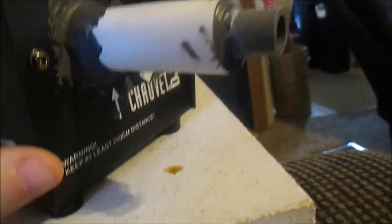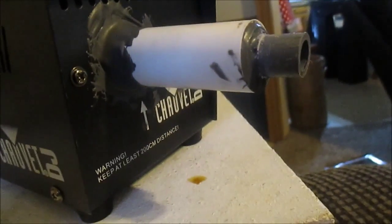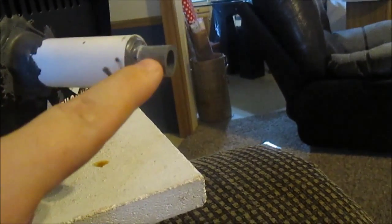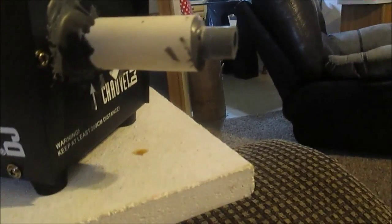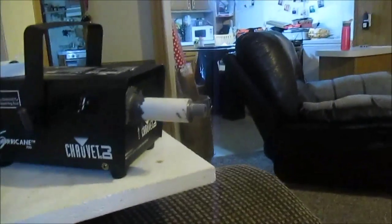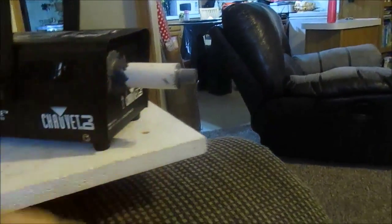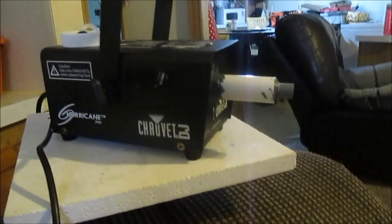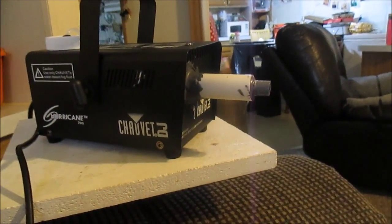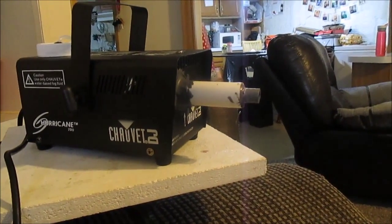This is an experiment. It's all plastic and I don't know if it'll hold, but if it doesn't I'll just rip it all off, clean it up, and use metal. Anyway, the point is I got this down to a half-inch output, and I can hook that up to different vacuum hoses and adapters. With some scrap stuff I modified this, and I'm going to use it to smoke out the intake on my Ford Explorer to hopefully find the vacuum leak. I think it will work.